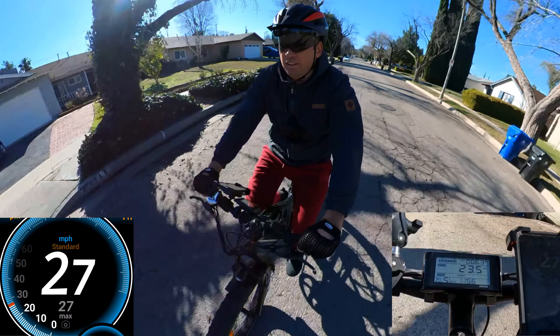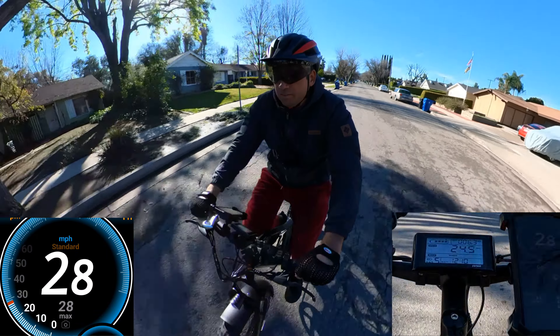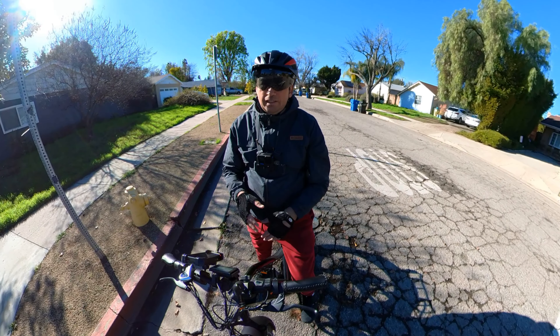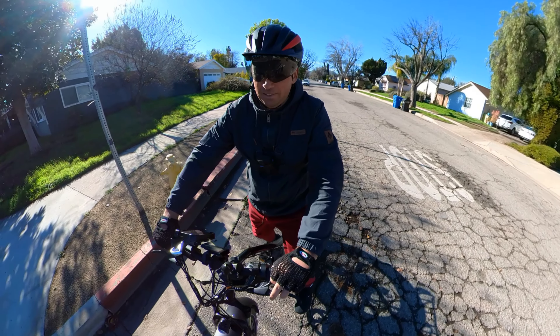It's now set to 100 and with throttle only at pedal assist level 5 — it's already at 21, 24 miles per hour, settling around 28 on GPS. That's about 30 to 31 miles per hour actual speed. Since I weigh 250 pounds, if you're lighter you can likely reach higher speeds. I do not recommend changing the programming — leave it at 28. If you change it to 100, your pedal assist level 1 will go up to very high speeds right away, which is not safe. Thanks for watching, see you in the next video!